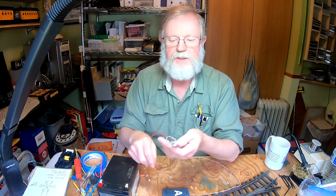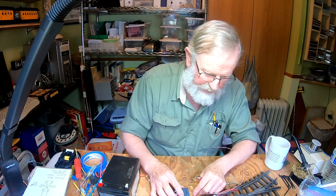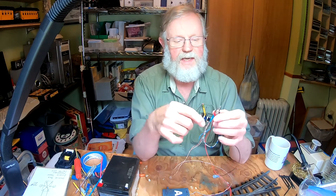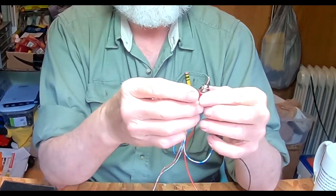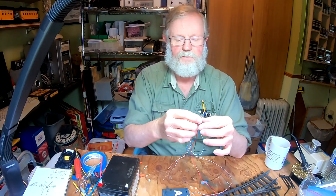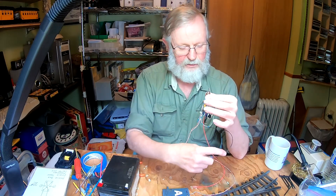Now I've wired this. The wiring on this: with this switch, the idea is on one side you want the current coming directly straight out — positive to negative — and it goes to the switch. But if you want to throw the switch the opposite way, you have to reverse the polarity on these two wires going in. So on one side it's a direct route, positive to positive, negative to negative, the dark and light wires. And then on the other side, I've run jumpers that go from here on this corner to the opposite corner, and the same thing on this corner — I've gone to the opposite corner. So it's just jumped straight across. So when you do put power in one direction it'll throw it one way, and when you put power the other way it'll go the opposite way. Let's try this out.